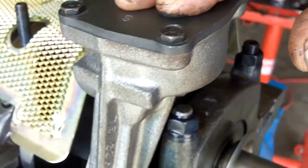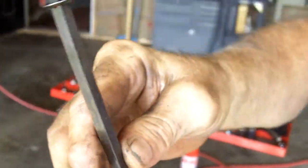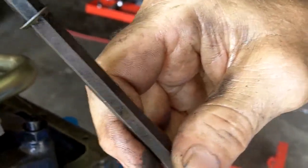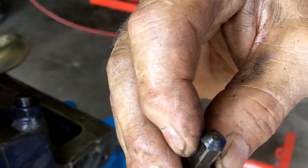The pump and the ARP shaft — the thing is you really can't see it, but it is similar to this except the ARP shaft is all solid here, so you don't get that twisting. This is actually the stock 351, which is much bigger than the 5 liter. The 5 liter is like a quarter inch; this is 5 sixteenths.